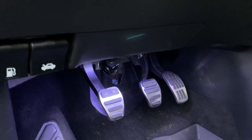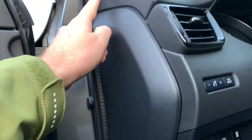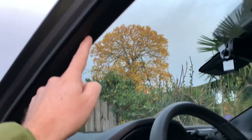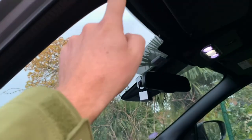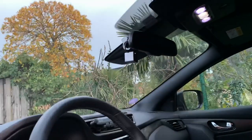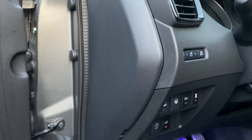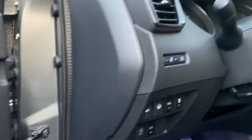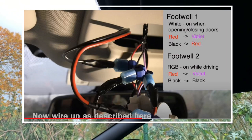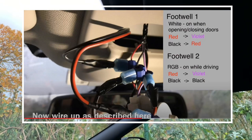The reason I always like to have an extra switch is to be able to shut down accessories that I mounted myself. As you can see in the video, both cables go all the way up, following the rubber, then behind the roof liner, and they're wired to the room lamp on top. When working on that, always remove the room lamp fuse. In the previous videos you can see how I wired it up — you have three cables on that room lamp and you have to use the ground, the continuous, and the switched one.